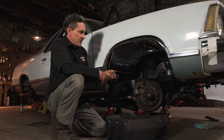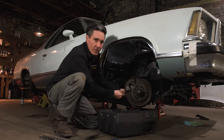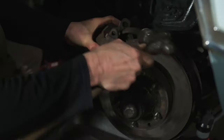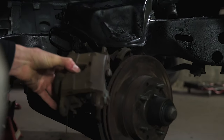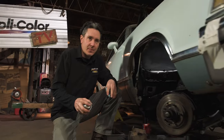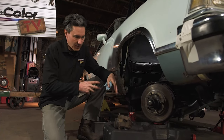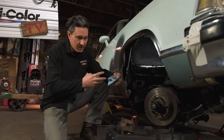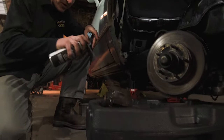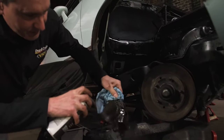Since I have to replace the hose, it's a good time to just remove the caliper. We can paint the caliper on the vehicle or off — but since we're replacing the hose, we might as well paint the caliper off the car. I have the caliper removed and I'm going to remove the line. When we remove the line, brake fluid pretty much goes everywhere. So I'm just going to hit this with some Dupli-Color caliper cleaner, let it drain into the pan, and get it good and clean. Then we'll get it up on the bench and prep it for paint.